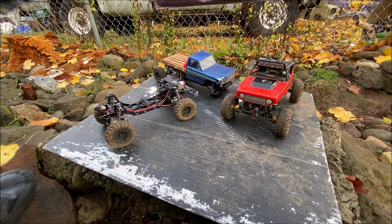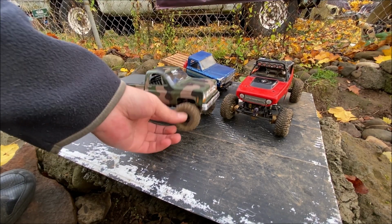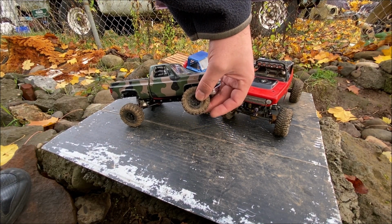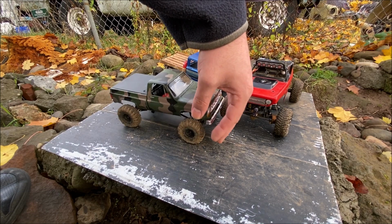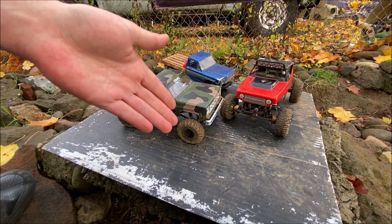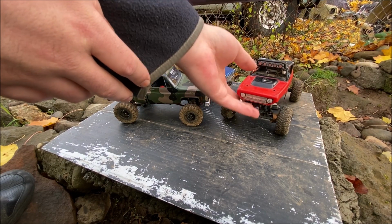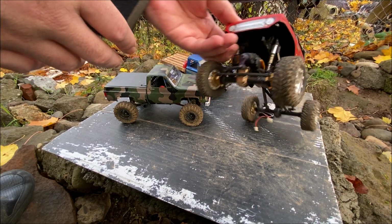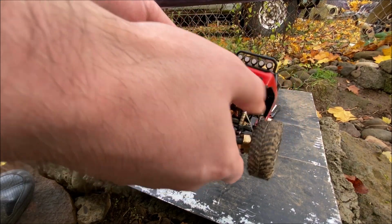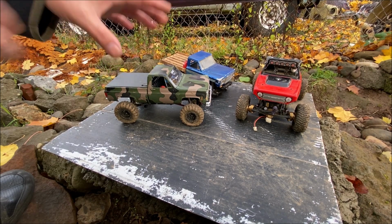So yeah, although it was limited on the C10 body because it's lighter, with this body, I've got almost my full flex. So that's pretty dang good. Plenty for this build. I am going to experiment with different springs though. I have the springs that come with these shocks here, and those are a lot longer, but they're basically the same as the stock springs. And I'm going to try that on here. Hopefully it'll sit nice and drooped and do well.